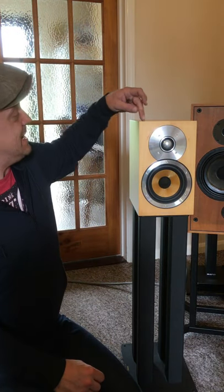We've got a two-way British mini monitor with a very deep cabinet for its size — a pretty chunky cabinet. It has the typical Bowers & Wilkins woven Kevlar bass driver with a phase cap in the middle, and these have what's called a Nautilus loaded tweeter. Most people will be familiar with Laurence Dickie's Bowers & Wilkins Nautilus — the £50,000 mega speakers with the snail-shell bass driver and tapered tubes on the rest of the drivers. This speaker has some of that technology: on the back of the magnet housing is a plastic tapered tube that absorbs backfiring standing waves from the tweeter. It's impressive that you're getting that washed-down technology from what's supposedly an ultimate speaker.